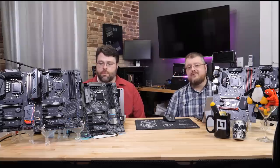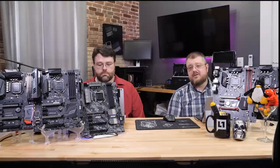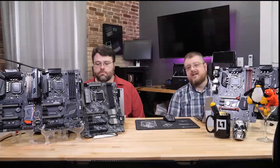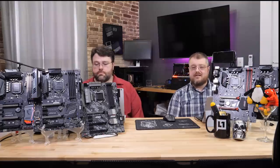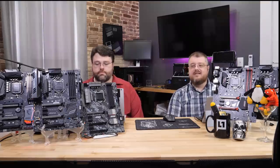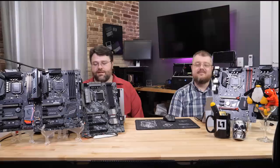On the other hand, for video, you probably want to go with more cores. I mean, 6 cores for video processing, maybe if you're on an extreme budget, but even then, some of the AMD options are probably comparable. So we can't recommend it for that. But audio for sure, budget gaming. And the other thing to keep in mind is you want to make sure that you're not in a situation where heat is going to bother you a great deal, because these things will generate heat if you're going to overclock it.